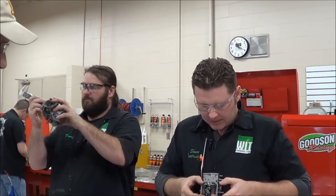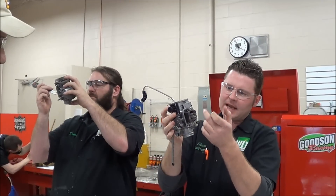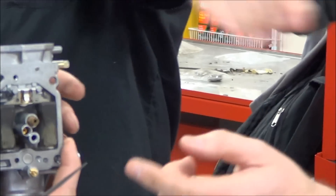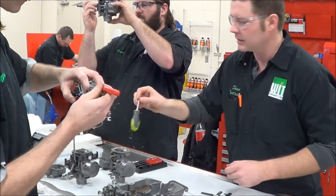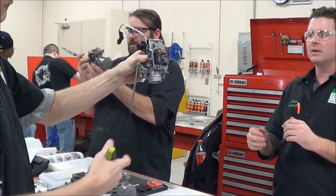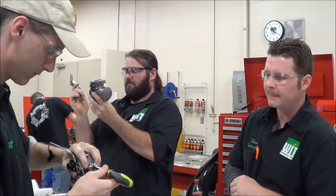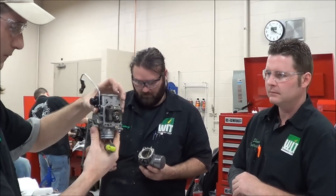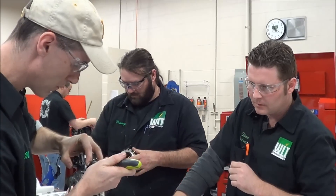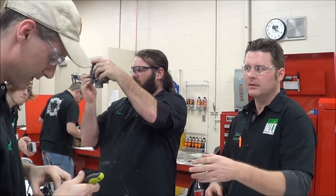I'm going to take it and get these level — see how I did that? Got those level. Now this one's too rich. Since he needs to bend this tab down, he can hold the carburetor up like so so he isn't hurting the needle, and push the tab down. Small increments — he's going to push down in the middle. Check your work at 35 degrees. He's made some progress and been nice and even because of how he's supporting the carb with his hand. It's his first time doing this, Shane. You'll get the feel for how much that metal's going to bend for you.